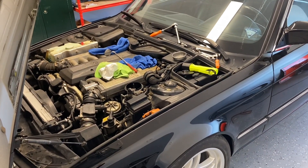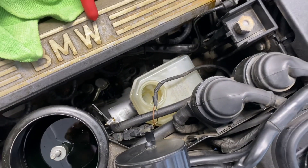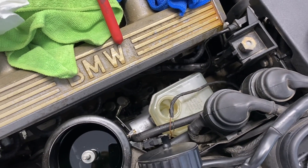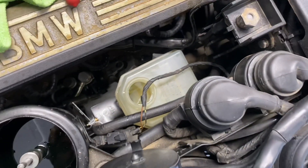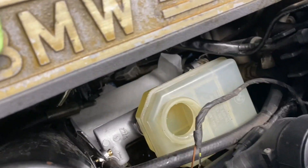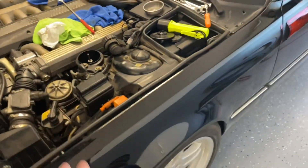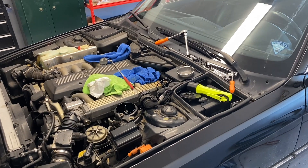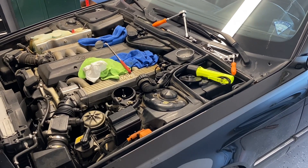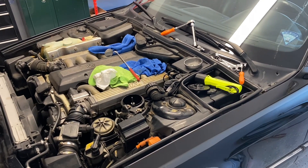Day two — aka day three, since I didn't work on it yesterday because my back and legs were killing me. The master cylinder — you can bench bleed it, but you're never getting it back in there with the intake manifold on and the reservoir on it. So I had to pretty much install it dry, sort of gravity bled it at the lines before I put the reservoir on. Loctite on the bolts to the booster, threw it all together. Then I noticed it started leaking again — you can see my napkin down there, it's going to drip on it. I fired it up a couple of times and hit the brake a bunch. I actually have a really good brake pedal — the brakes are working very well. I can look under there with a mirror and see that notch under the booster at the seam of the master was wet and leaking. However, since running it and hitting the brakes a bunch, it doesn't seem like it's leaking now.